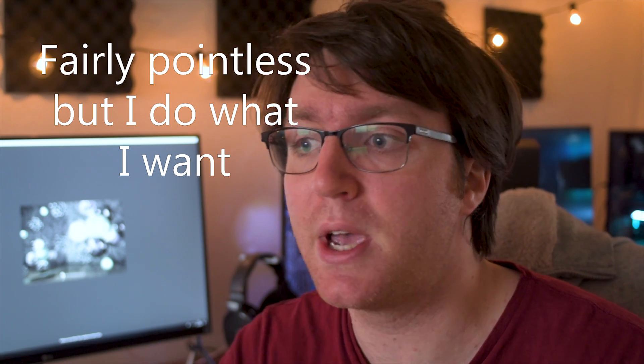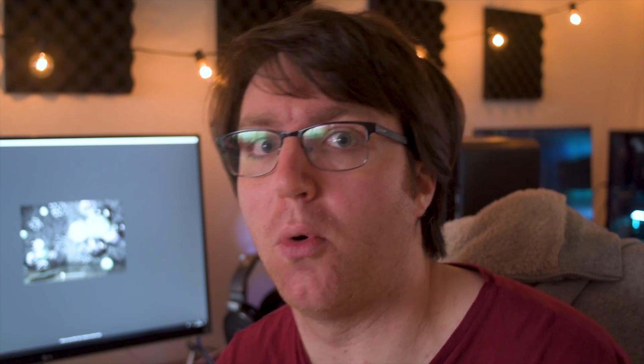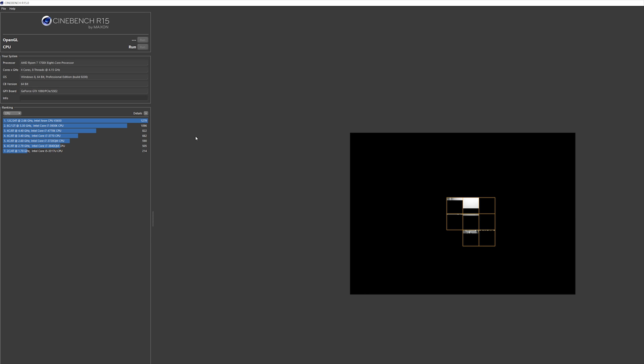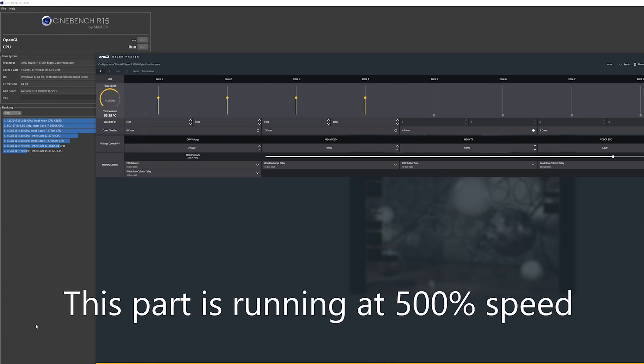So now I'm going to see how far I can take the CPU by turning off cores. I'm going to use Ryzen Master to turn off some of the cores and then see how far I can push it. What I've done to this point is I've actually turned off four of the cores, so it effectively turns it into a quad core, and Cinebench ran at 4.1 GHz. For some reason that worked at 4.15 GHz — I actually finished a Cinebench run, which is pretty exciting. I think that's quite a high clock to get on a Ryzen CPU. But because it's only four cores running, it's not a particularly high performance benchmark run — I was only getting 842 points in Cinebench as opposed to the 1770 that I got with all eight cores on.